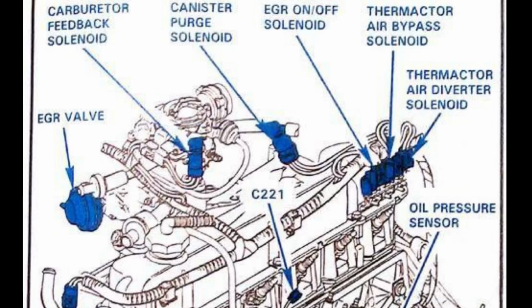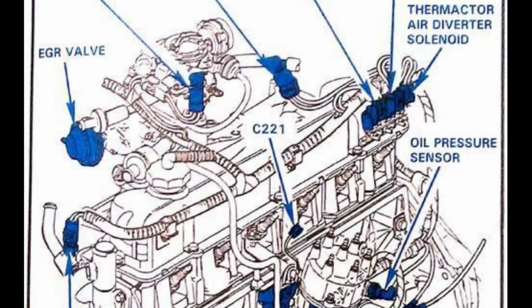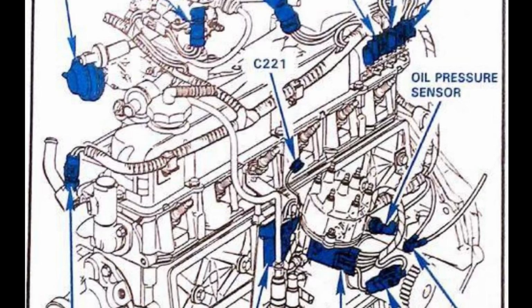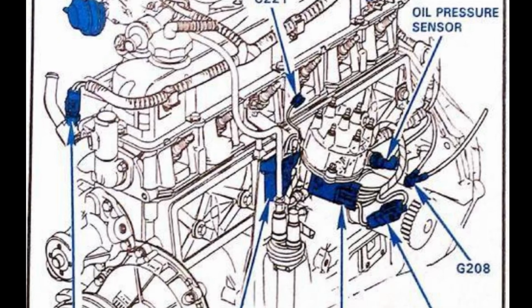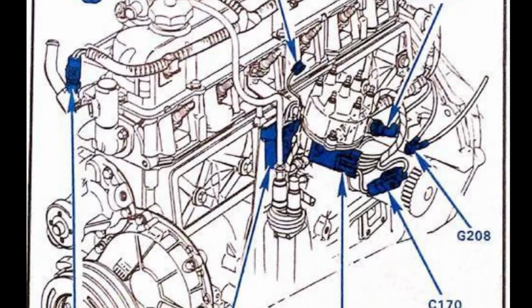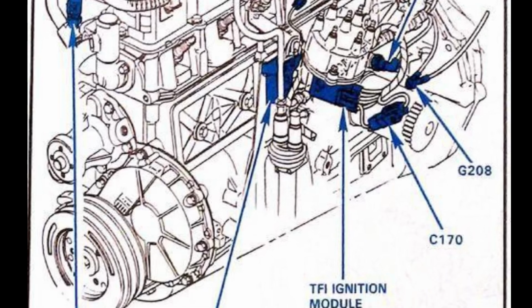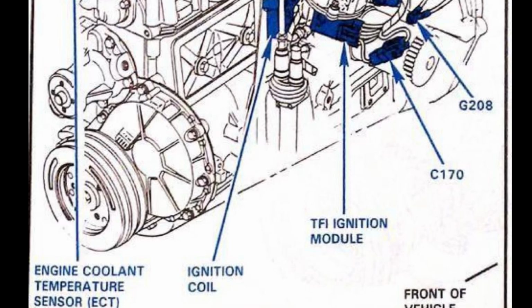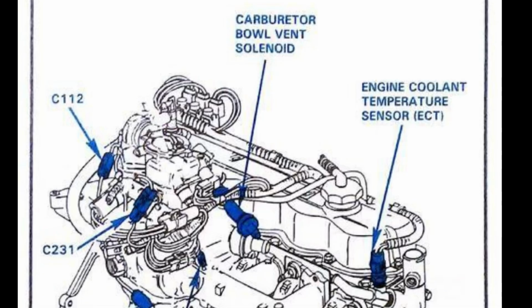Ford would also offer a larger stroke option on the 240. Stroke was 3.98 inches, bringing displacement up to 300 cubic inches. It's important to note that both engines are virtually identical in appearance on the outside, but inside the rotating assembly and combustion chamber size in the head are different. Larger combustion chamber on the 300. But with that said, the heads are interchangeable because the block is the same.